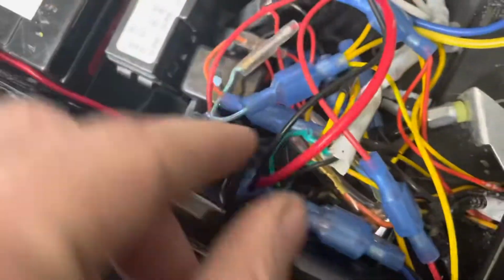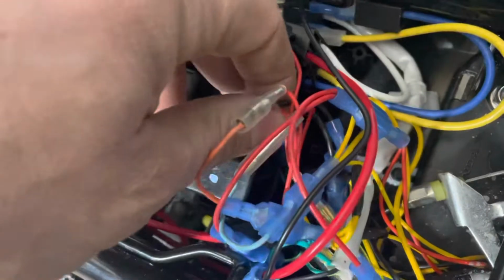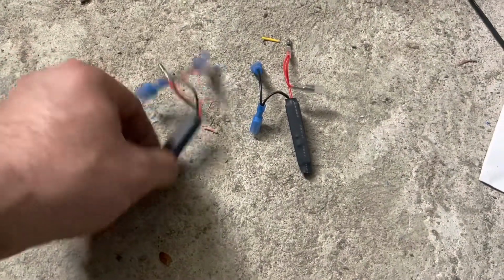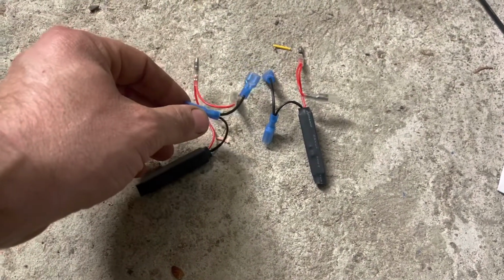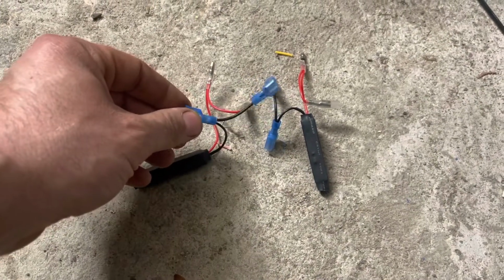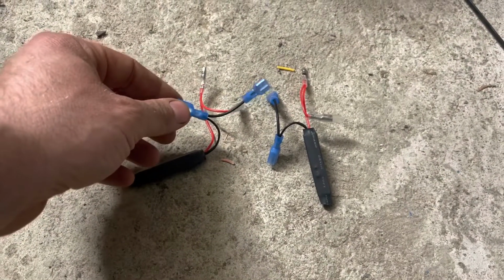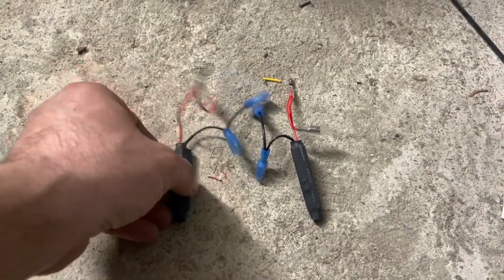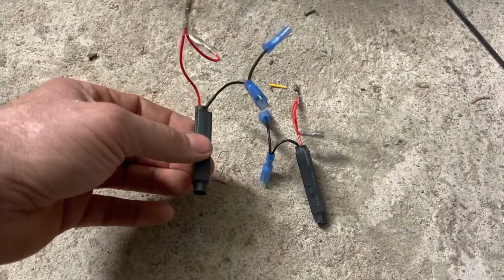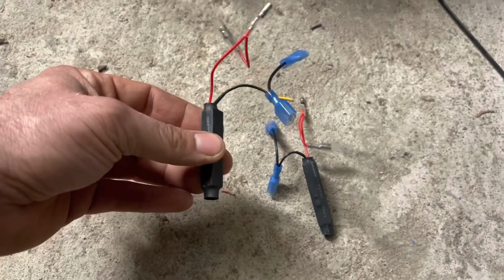Power stops going. And if I go through this little mess here, there they are. We'll be taking these out, but I wanted them in here just to explain what's going on. Just to interject, these are what the resistors look like, and they're hooked in parallel with the actual circuit. Basically, as I wired it up, you could just easily disconnect it, and there's nothing wrong as long as you reconnect the negative to the negative and the positive to the positive. So as you see here, one is an in, one is an out, and that's how it works in parallel. So it puts a load on the circuit to fake the incandescent load when LEDs are now present in the place of the incandescent light bulbs.